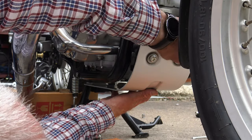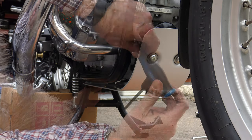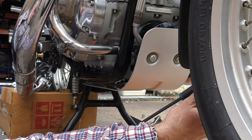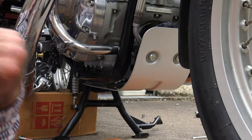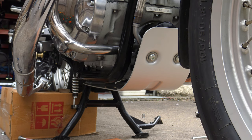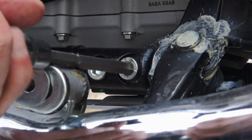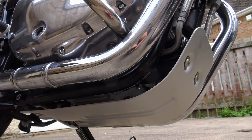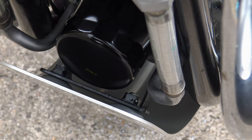Time for the first test fit of the sump plate. Using the washers and bolts provided, insert all bolts and screw them up hand-tight. This presses all brackets flat against the sump guard, putting them in the position they need to be in. Make any adjustments to the angle of the front bracket by pushing or pulling the front of the sump guard, ensuring a respectable gap between the bracket and the oil filter. Then torque up the bolts at the rear of the engine cradle to 45 Newton-metres.